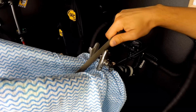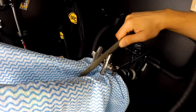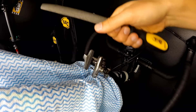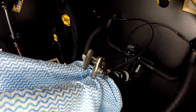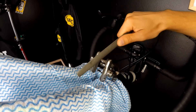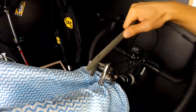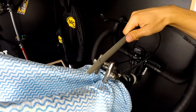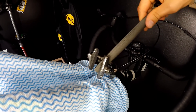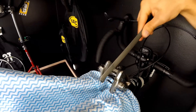It wasn't enough just to use a screwdriver to remove the little rocks from your braking pads. What's important here is that I don't want to change the angle of the surface of my braking pads. You'll always alter it just a little bit, but after maybe three or four braking sessions it will be even and parallel to the rim again. I have to be careful with my brakes here, so just do it little by little and you'll see what's still underneath the surface. The braking pad should be very, very clean.